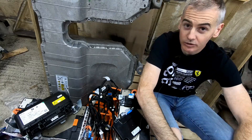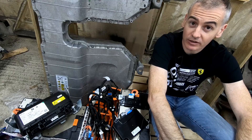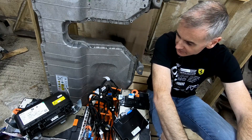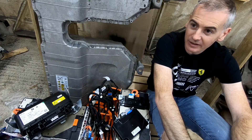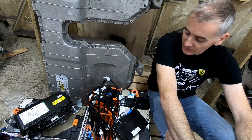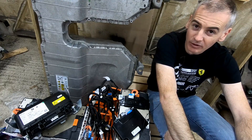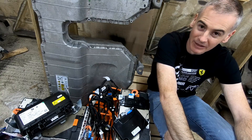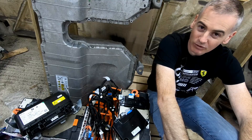So there we have it — one deconstructed BMW battery pack. It's quite cool to see how a different manufacturer does the battery pack: different battery modules, different way of constructing them. I think there's probably a lot more dead space in this one. The Leaf one was maybe better packaged in terms of making use of all usable space, but this one was very smartly engineered in terms of how easy everything is to connect and how reduced the risk of accidentally shorting something was. Compared to the Leaf, where in order to break apart the pack you did have to expose screws on the individual modules and unscrew them — which meant there's a risk of dropping tools on them or something like that.